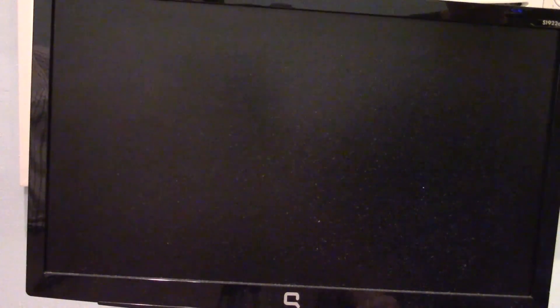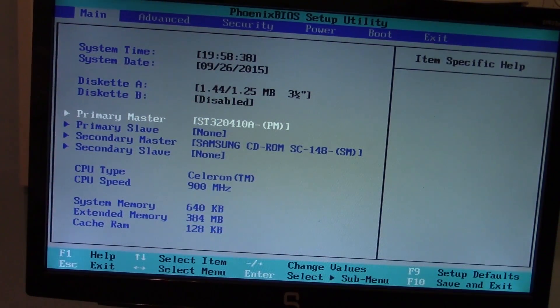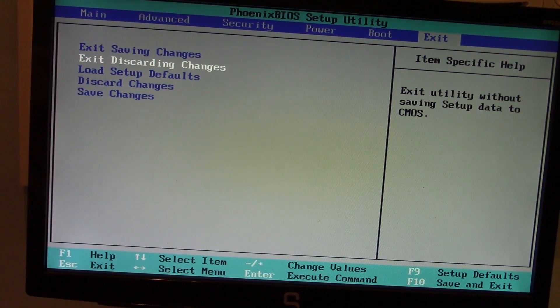I'm going to try to shoot this in one continuous take, so you guys don't think I am lying to you — there's not going to be any video editing voodoo going on here. So let's go ahead and turn on the system. I'm going to go into the BIOS and show you guys that there is indeed 384 MB of RAM installed on the system. And right here, if you look towards the bottom, you can see 384 MB of RAM are registered in the system. So let's go ahead and boot up into Windows 7. I have our USB flash drive already plugged into the system, and we're going to boot into the PLOP interface first, and then from there select boot from USB.